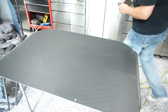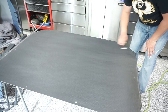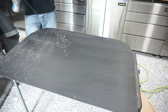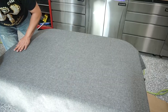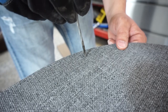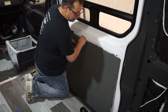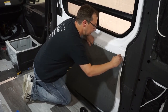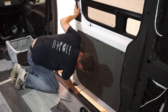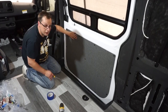Hit subscribe — and this grey fabric is just gonna get glued straight to our plastic. The first thing we're gonna do is take some emery cloth and sand it down a bit just to get all the clear glaze off of the plastic. Then we're gonna take our fabric, cut it to size on top of our piece, and then use our spray adhesive — we spray on the plastic piece as well as the backside of our fabric and then we just stick them together. Wrap it around the back, then we make our holes where our clips are gonna go through. We just took a hot nail and a blowtorch, found the hole with our finger, and then pressed it down through — and we did that for every single hole. Makes a perfect hole every single time. Then we can just take our panel back over to the van, take those plugs, shove them back into their holes, and there it is — our first finished panel inside the van.